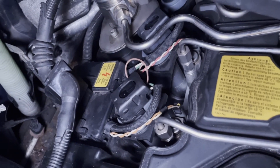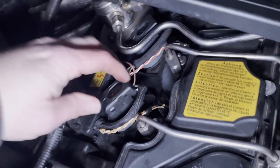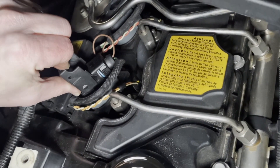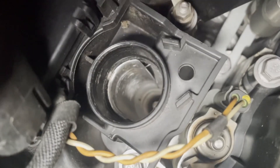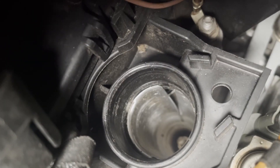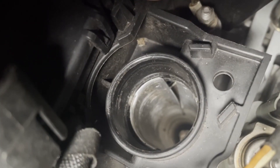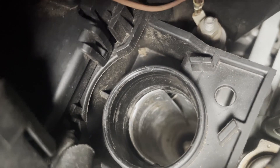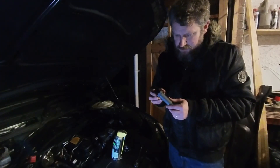What you need to do is pull a little clip up and over, and that lets you disconnect the wiring. As you lift this up it actually ejects the wiring from the coil pack, which just comes off like that. These cars use a bespoke spark plug with a 12-point socket, and not only that, they're incredibly recessed and slightly offset. So I'll need to get the right tool for the spark plugs. For now, I'm going to swap the coil packs around and clean up all the connectors to see how it runs. This is the ignition coil that was misfiring.